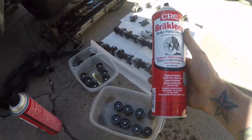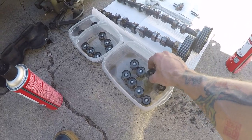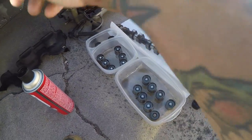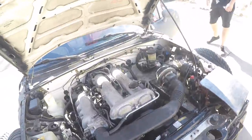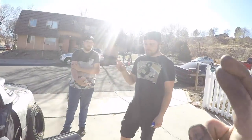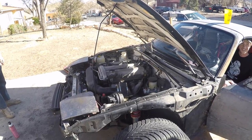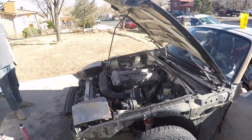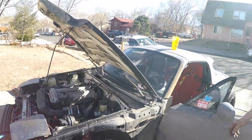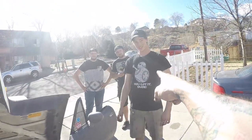We got these guys soaking in the ozone-destroying brake cleaner — not that sissy stuff, non-chlorinated — and then once these soak for a little bit it's going to break up the oil deposits inside. We'll pull them apart one at a time, clean them in another clean bin, have them ready to install, and then drop them in one at a time in the order they came out. Mission accomplished — got everything back together, hopefully she starts. Got a freaking dollar on the line, bro. Still gotta pressurize, gotta get warm and circulate everything. Doing oil change and all that. Alright buddy, sweet. Like, subscribe if you want — as always guys, keep on modding.